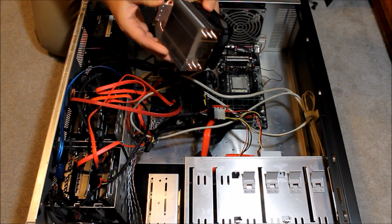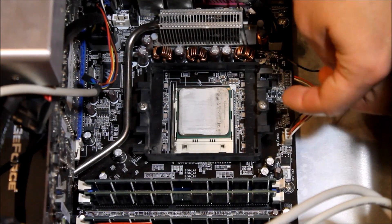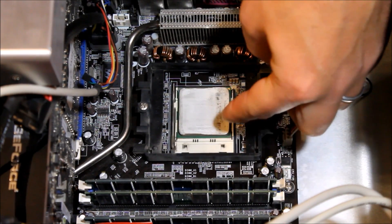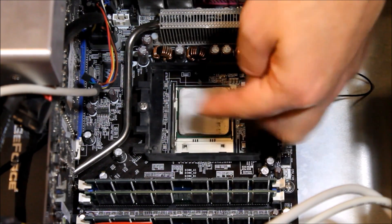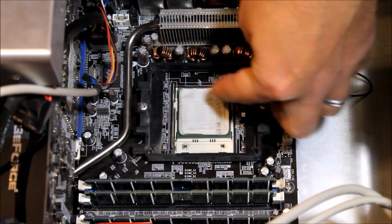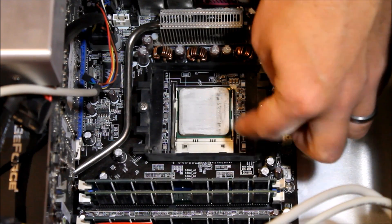I'm going to bring you in a little closer and we'll start by taking the old processor out, getting it cleaned up a bit, and getting it ready to put the new fan on. So we're in close here on the processor itself, and you'll notice some silver gunk on the top. This is something we need to get cleaned off to make sure we have a nice smooth surface to attach our new fan to. We don't want any gunk in there — it'll interrupt the heat dissipation. So the first thing we need to do is get this cleaned off.